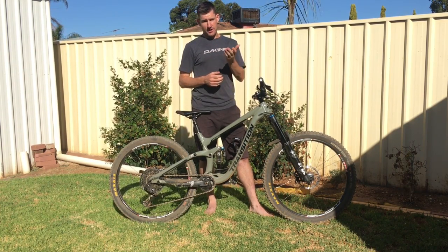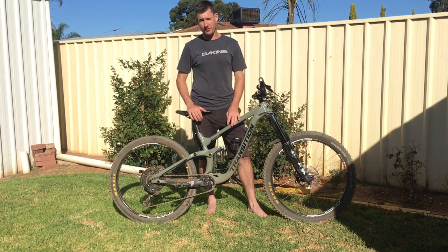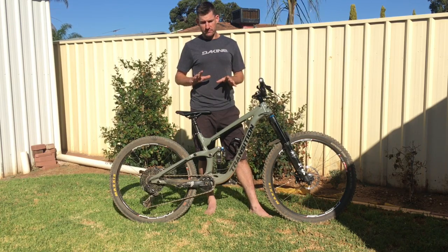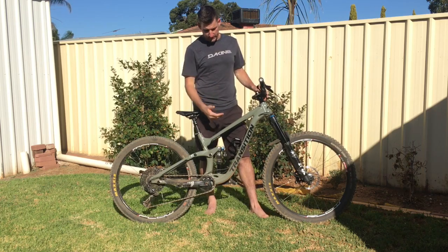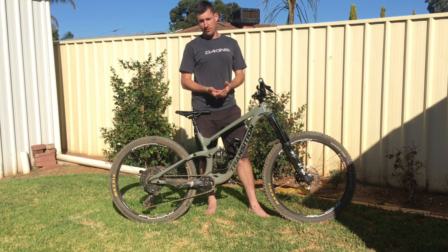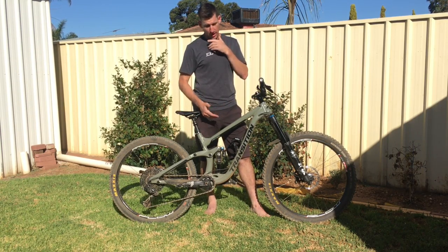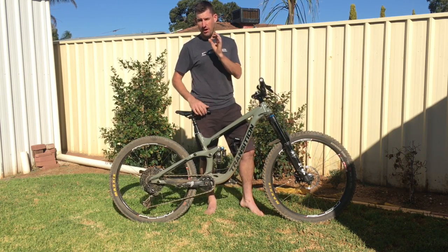Zero spacers, pressured up. When I first did this, I reckon I was running at 170, 172 psi with the zero spacers, and it was blowing through its travel too easy. It was super smooth, but it was blown through its travel a bit easy. 175 felt excellent, but once I started charging real hard on the pace today at Fox, it kind of showed that it was still a little bit not quite enough ramp at the end of the stroke. The spring was going through the whole travel, so just in the big hits there was the potential of bottoming out, and it just wasn't quite as efficient as I like.